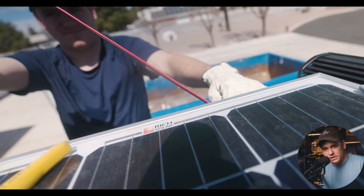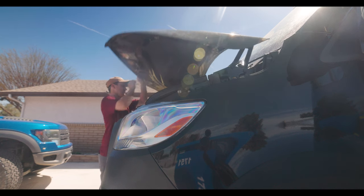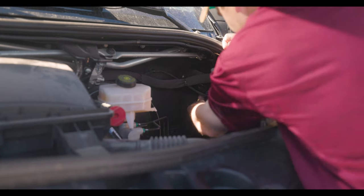The wiring harnesses that came with the lights were way too short, so I lengthened those wires using the proper gauged wire with butt splice connectors and heat shrink to make sure everything was protected. I then opened the hood, exposed the already-run wire grommet, and used my fish tape to pull through the LP9 light wires — that part was pretty much done. It was then time to wire everything through these awesome switches I got off eBay. They're 3D-printed to fit the actual slot, which saved a lot of money compared to the real version at about $90 per switch — I'll link those down below.